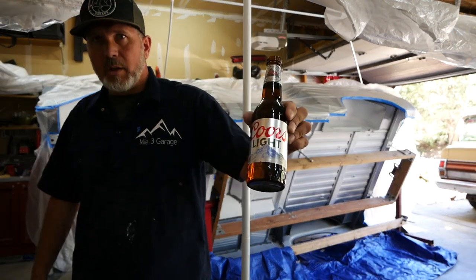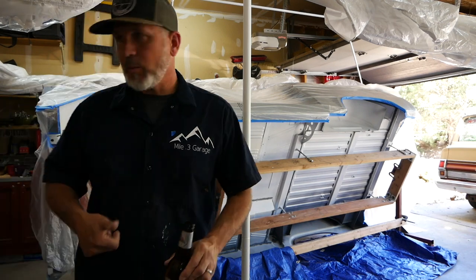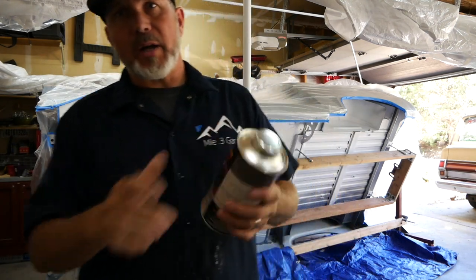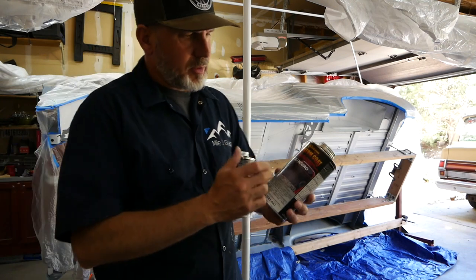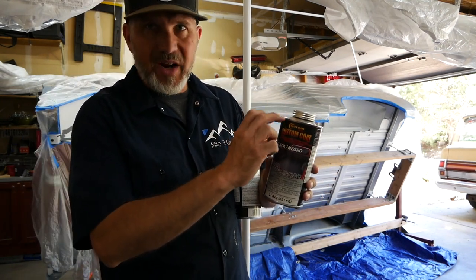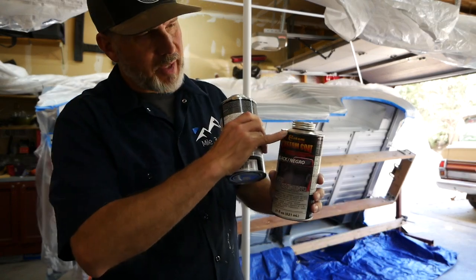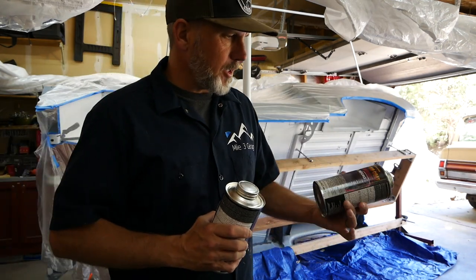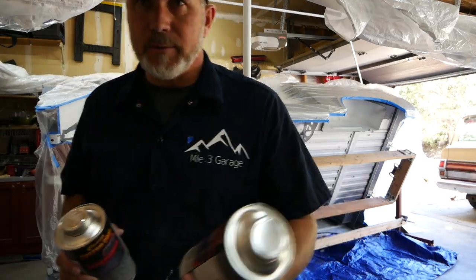Second step, bottle. There's no moving parts or cutting hazards, so I think we're okay with that. And then the assembly of the bottle. So I'm actually going to be spraying directly out of this can. This comes 2/3 filled up, and there's still 1/3 left of air. Open this up, fill the rest with hardener all the way up to the lip, and then shake the heck out of it to get this thing mixed correctly. Then we're gonna shoot it.